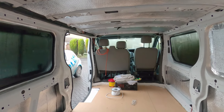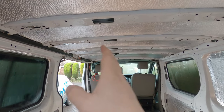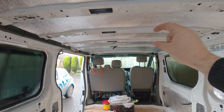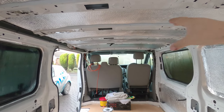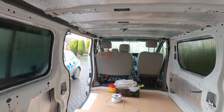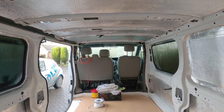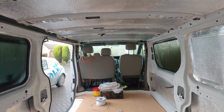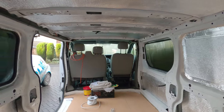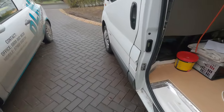Thirdly, lighting wise, I hope this makes sense, there's going to be a section about 18 inches wide down the center of this roof that is lower than the outer portions by about 20mm, and around the outside of that, lighting outwards towards the windows, is going to be a strip of LEDs. They're going to be colour changeable LEDs, so I can create a bit of mood lighting in here if I ever want to, and they are going to be switched from over at the main control panel over here as well.